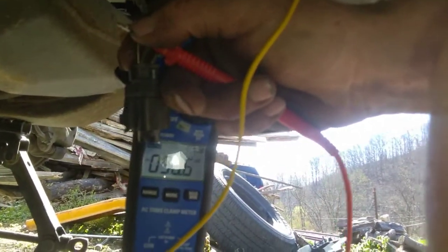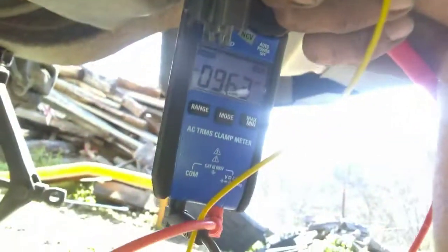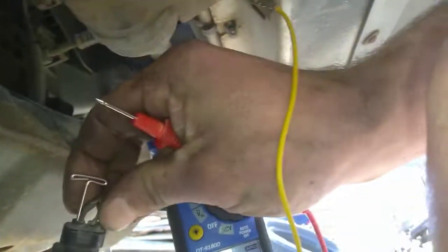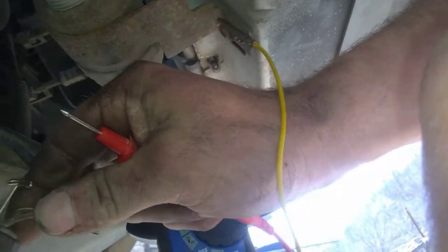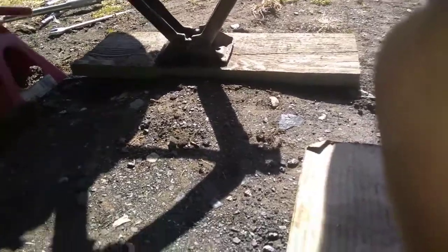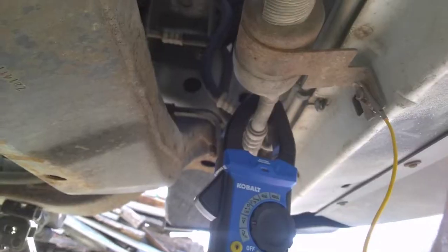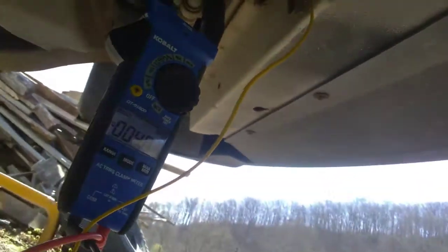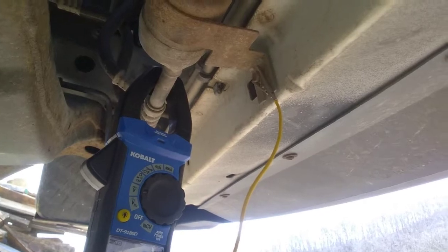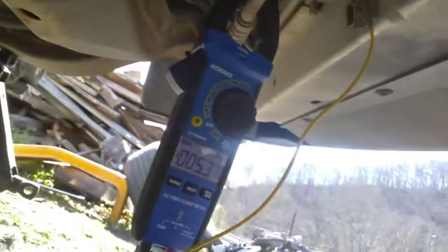On our ground we're reading 96.5 millivolts — that's a little high, but our ground down here isn't that great. I'm going to switch back to one of the two we think is the reference: the brown/white or the second one, which I believe is yellow. We're back to 5.12. I'm going to plug this back into the sensor — you'll hear those fans die off. Now that the fans have cut off, be very careful not to touch this T-pin to any metal. You will short out that wire. You don't want to short out a reference wire.